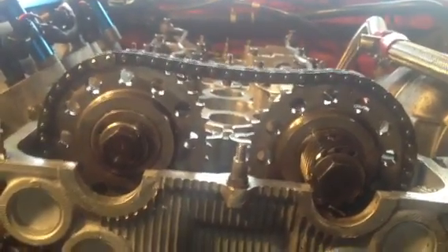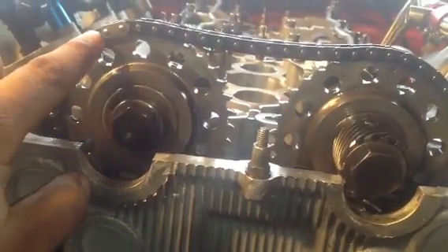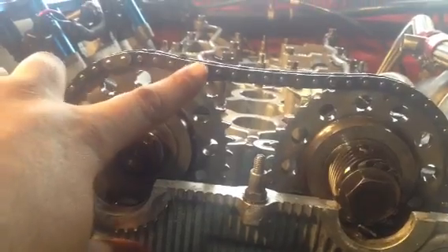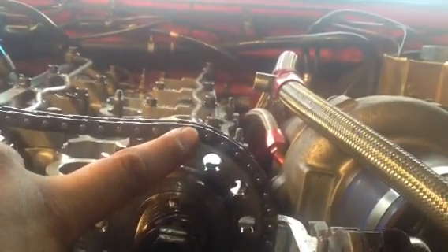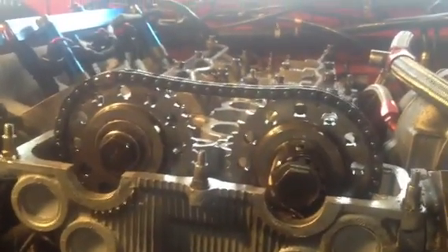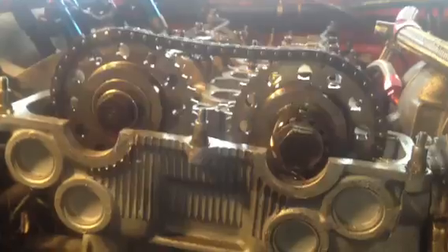If you want to count the rollers — because I didn't match up the chain — we count: 1, 2, 3, 4, 5, 6, 7, 8, 9, 10, 11, 12, 13, 14, 15, 16, 17, 18, 19, 20, then we get a dot. So we're verifying that we got 20 notches on the rollers, we're at 45 and 12, and we're at TDC at the crank.